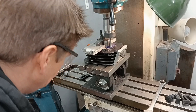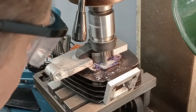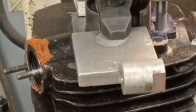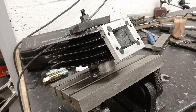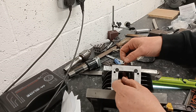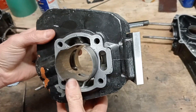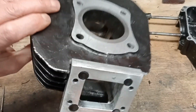Right, let's get to the mill. I'm not sure how long I'm going to show this because I can only just about see what I'm doing myself. I was always told when you're filing or using emery cloth — and actually this is the direction of flow — so it does assist the flow a little bit. Whether it does in reality I'm not 100% sure, but it sounds plausible. Okay, that's the barrel all done. Made a better job of that bit, but overall I'm quite pleased about how it looks. How it's going to perform, I guess we'll find out with the dyno.